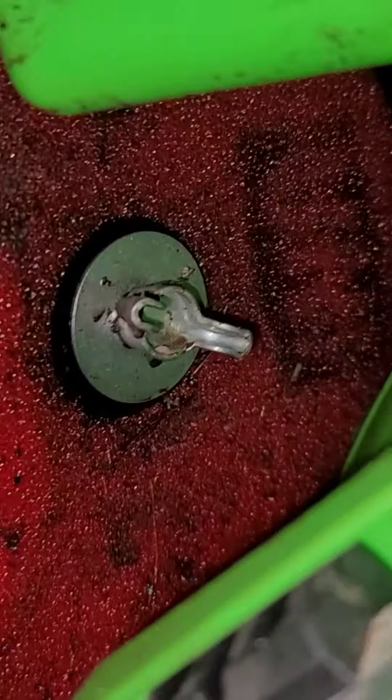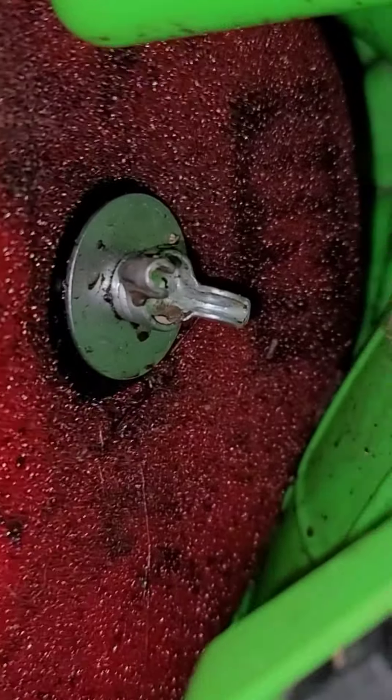Pulled the air filter out of its box. For the most part, not too bad — has little specks of mud here and there, but most of it's just right on the surface. Not enough dust happened during that race to even plug the filter up at all. A lot of this stuff is just sitting on the surface — little pieces of grass and whatever. I'm gonna make the call and say it's good, and I'm gonna leave it in.